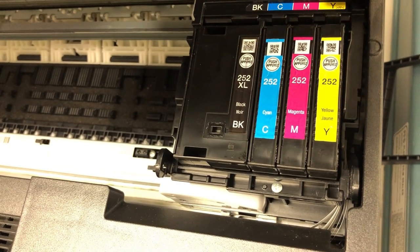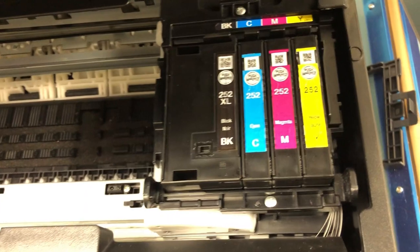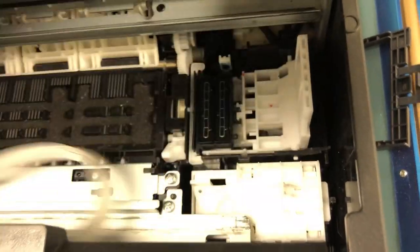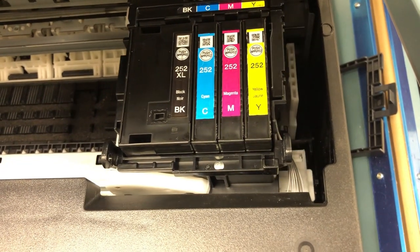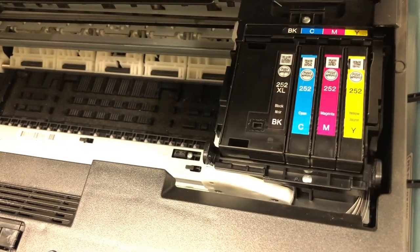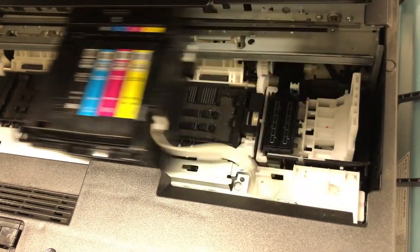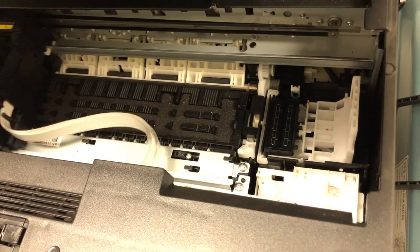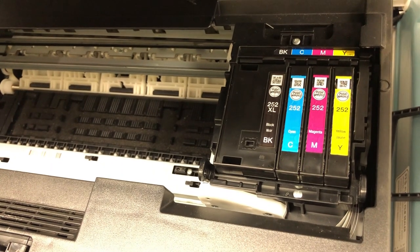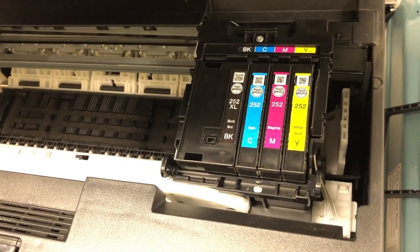By the way, the printer has different sizes of startup sequence depending on when you shut down the printer, whether there was a paper jam, or what the position of the print head was at the last location. That's why we set the location in the middle and create a fault by ourselves — so the printer will go through the whole adjustment. You can see right now the printer is not dragging that piece of plastic anymore. If you still see it dragging that plastic piece, the whole assembly is out of line and you'll probably need a new one. I cannot guarantee replacing the waste tank unit will fix the problem, but that's probably where the problem is.